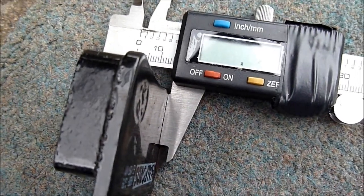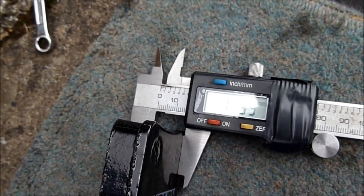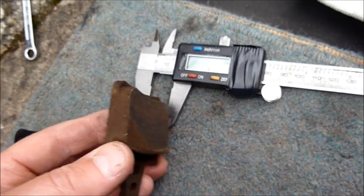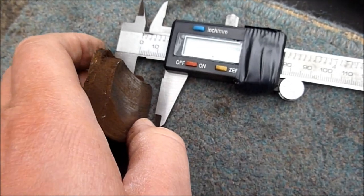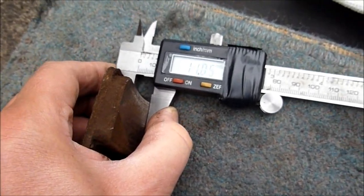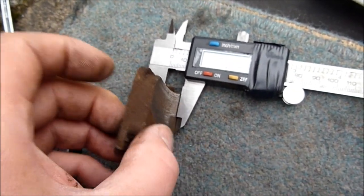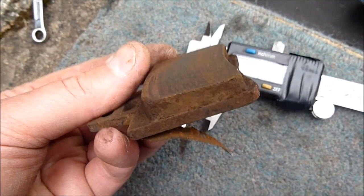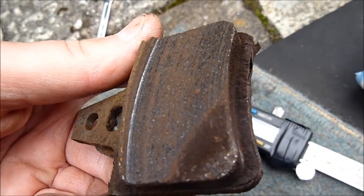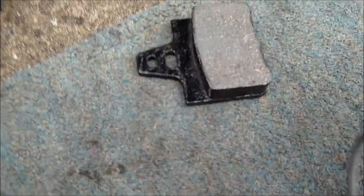The thickness is measuring 15.53, so about 15mm thick. If you look at one of the old ones — that was obviously set at 15. The old one is measuring below 11mm. Still a bit on them, but if you looked at the difference they have lost quite a bit. And this particular one has been wearing a bit of a step on it, which is not ideal. So it's worth changing.